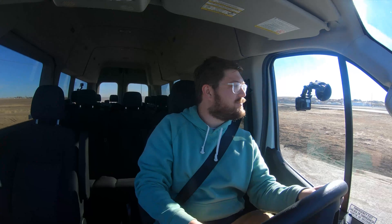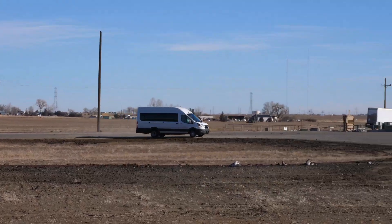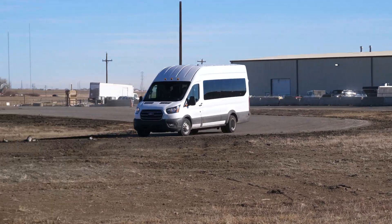Let's talk about driving dynamics of the Lightning E-Motors — but first, how this is constructed and why we're doing a track test. This is a Ford Transit shipped by Ford that Lightning E-Motors, a Colorado-based company, puts an electric drivetrain in. They use two 43 kilowatt hour battery packs in this transit version, giving an 86 kilowatt hour battery pack with about 125 mile range.